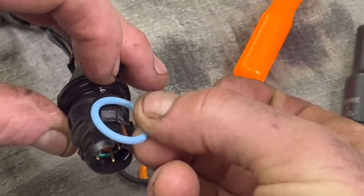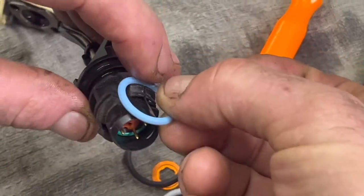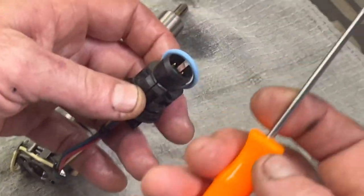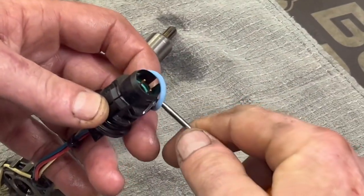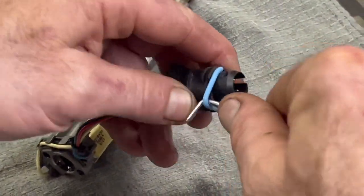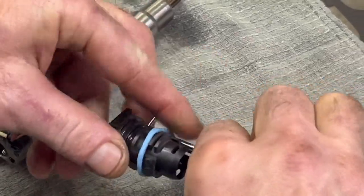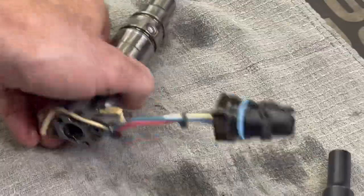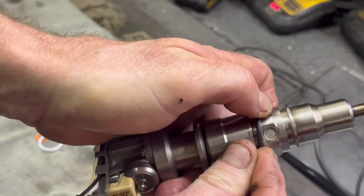Put this underneath this lock right here, the hold down. Put this on that side of the notch, and you still got your 90 degree pick. Take the 90 degree pick and hook it, and you want to get it through that notch. See, right there's the easy part. Now that's the hard part without a pick. And then you can just spin the pick around and walk it and then just pull the pick right out. It's wonderful. Let's roll this O-ring over it.